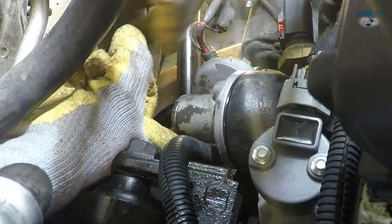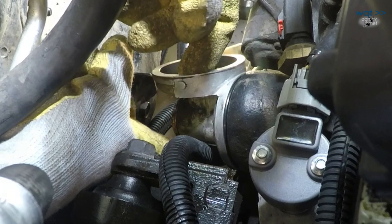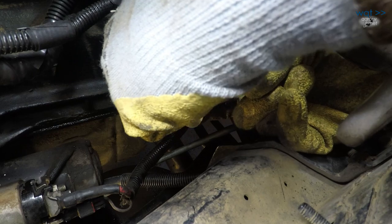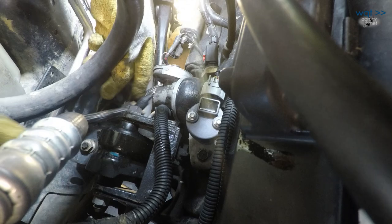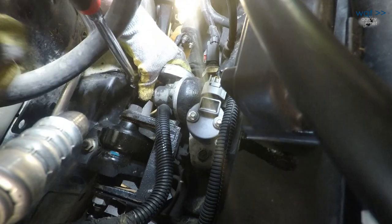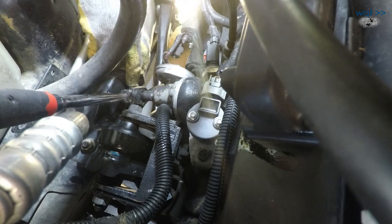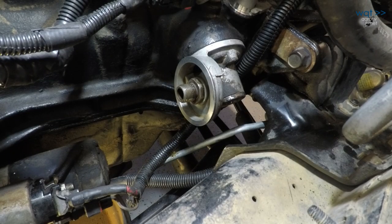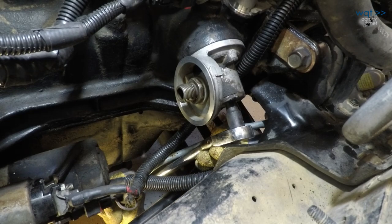In case it's not obvious what I'm doing — there's enough friction on the O-rings that when I pull this up, I'm turning it to the right, then I put my finger here and hold it so I can turn it back again. Now we're starting to bind into that alignment pin, so I think that's as far as it goes that way. We're on the alignment pin and I can feel the O-ring tensioning up. For final torquing, I'll try from the bottom to finish putting a full torque on that. That's pretty tight.